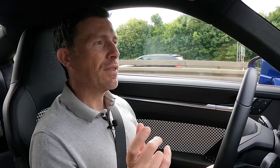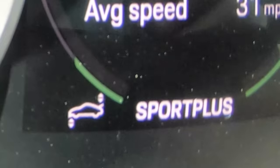There is an advantage though to the manual gearbox. One of the problems I have with my Turbo S is the fact that I like to run it in sports mode for the engine. That means that you've got the sharp throttle response. However, you can't actually separate the response of the engine from the gearbox also being in sporty mode, which means it's always holding you in too low a gear, which isn't so relaxing. You don't have that problem here because with the manual, you're choosing the gear, then the sport mode just controls the throttle response, which is good.